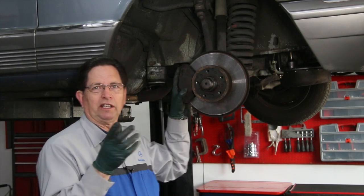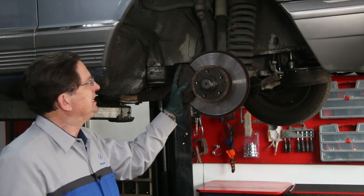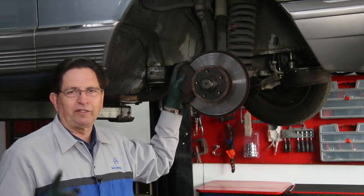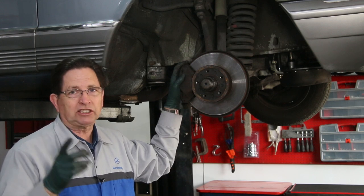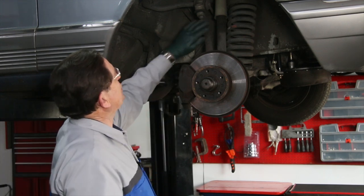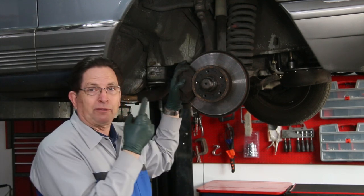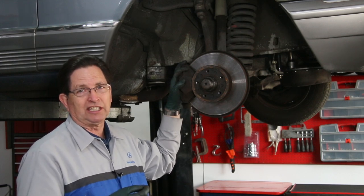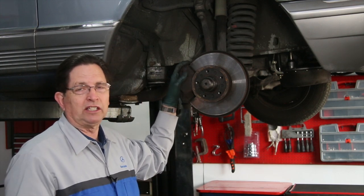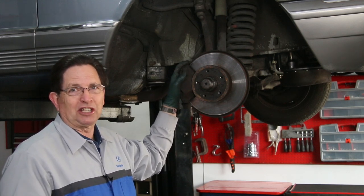Just a taste of the next video: we've talked about brake restoration — that's really the number one safety issue. The other thing is shocks. People don't think of shocks as a safety issue, but they do affect the handling of the car. In a panic situation, swerving to avoid a car or heavy braking, shocks can be critical in whether or not you avoid an accident. This shock here is leaking — you can tell it's been leaking fluid. One of the best ways to test them is just to remove them. We're going to go look at another car to show you how you can tell the shocks are bad by just doing some testing on the car itself.